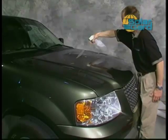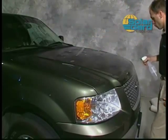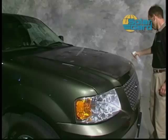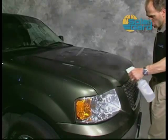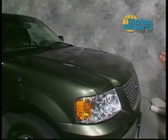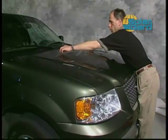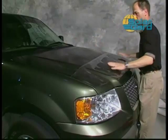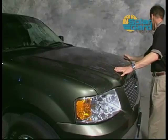After the liner has been removed, liberally spray the soap solution on the exposed adhesive of the pattern. Also, spray the area of the vehicle to be protected. With clean hands, grab the pattern in such a way that you can easily and carefully flip it over and position it properly on the hood. You will now perform all the installation steps demonstrated in the previous example.